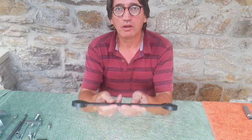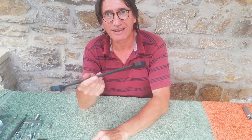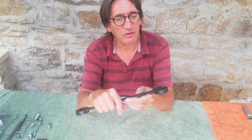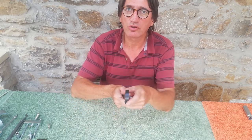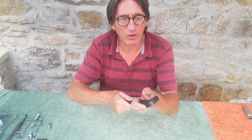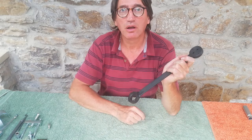This is a bit of a brute of a tool — it's for doing up and unscrewing the caps off the back of brake disc calipers. If you've got those beautiful clamshell brake disc calipers on the later 850 Nortons, this tool has two little lugs that fit into the lugs on the caliper cover and unscrew them without damage. Otherwise you're using a punch and always making a mess of those holes. Other tools in this set are also used for removing lock rings on the wheel hubs.